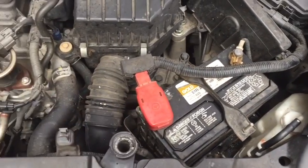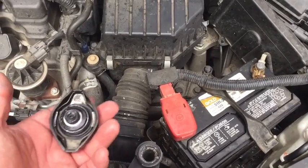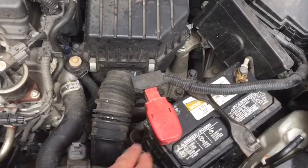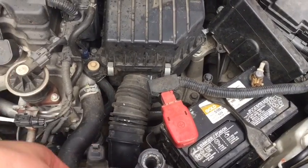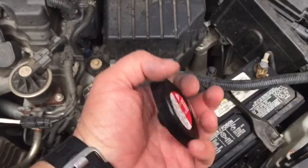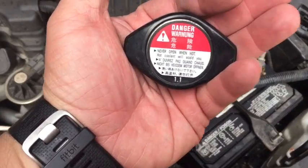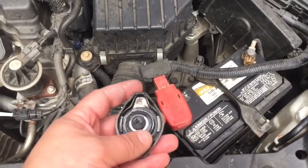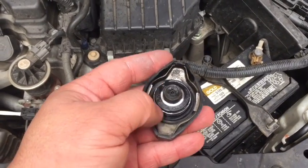So I took off the radiator cap and thought, I'm probably not holding good pressure in my radiator cap, because I shouldn't see it pushing any coolant until the engine is warmed up and we're developing enough pressure to get above the pressure of this cap — that's a metric 1.1 bar, around 15-16 psi cap. So I said, okay, maybe it's just a bad cap.